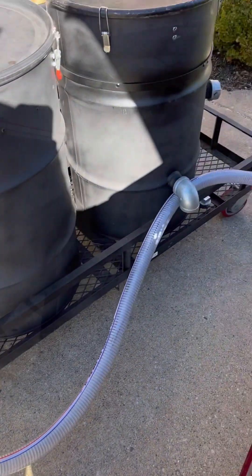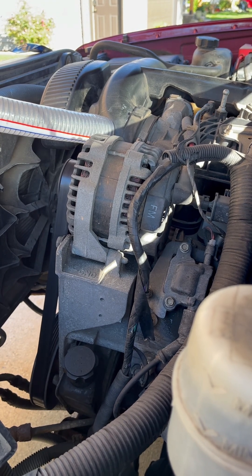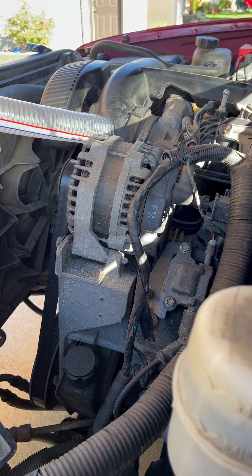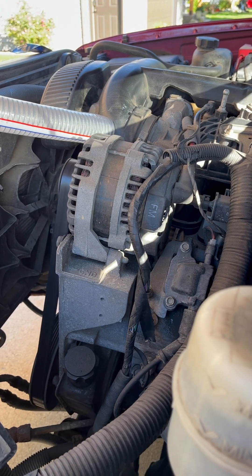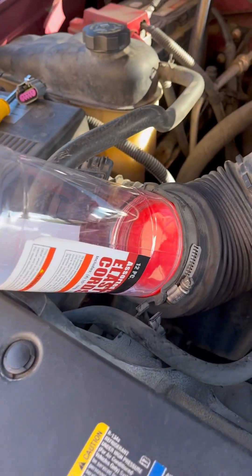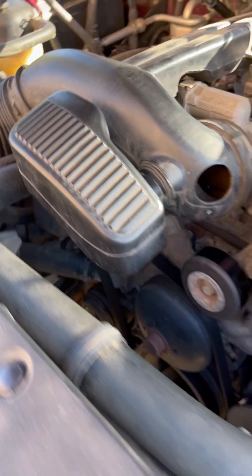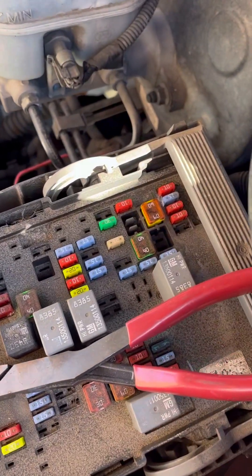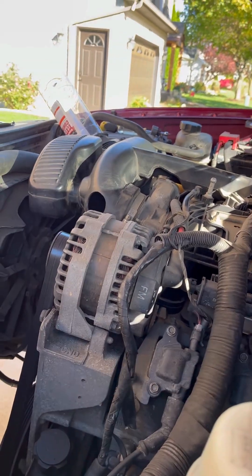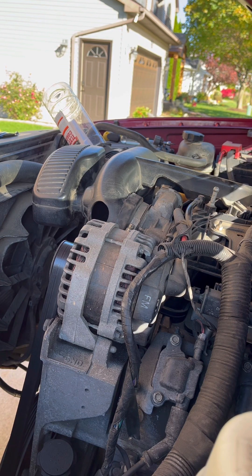We'll try this one — it's starting up, but it's not going to stay running. My idea now is to actually block off my air intake completely using a hose clamp, so there's no other air being sucked in through the engine. The only air it's going to suck in now is my wood gas. The fuse is still out, so now we can try it with straight wood gas, and I can use my other valve to make it leaner or richer.